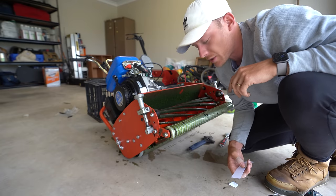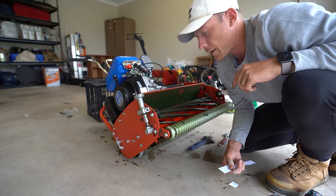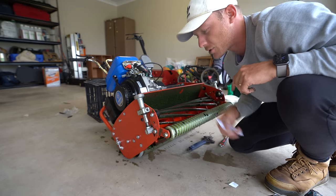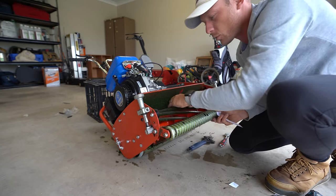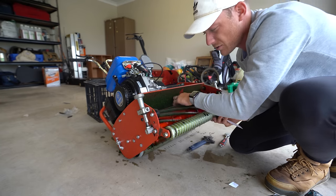It tends to get like that with cool season grass. And little spindly bits coming out the top. And I'd say that's because the reel is a little bit too tight. So I've had to adjust it down just to get the cut. You should be able to do it where it's basically not contacting and you're getting a nice clean cut. You can just hear it.